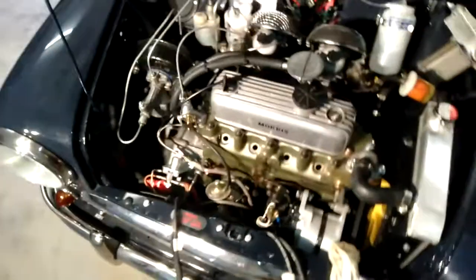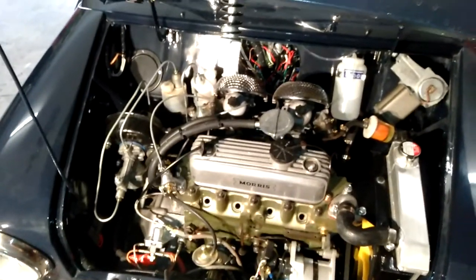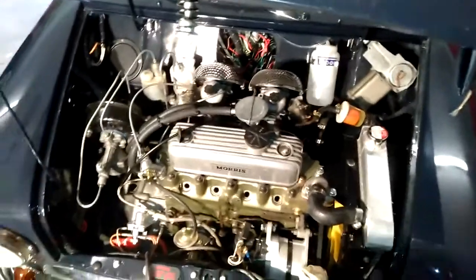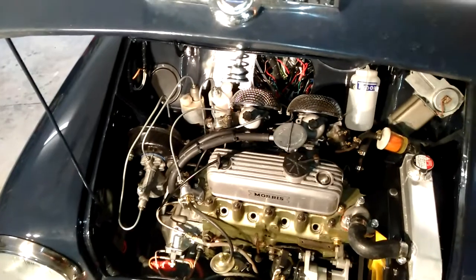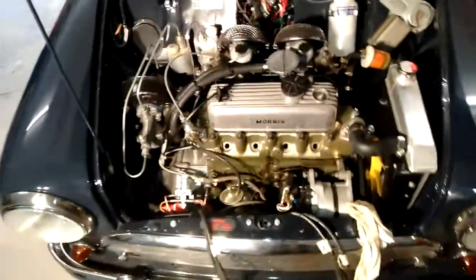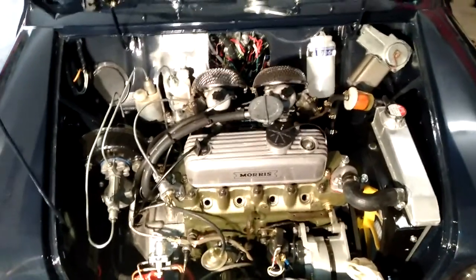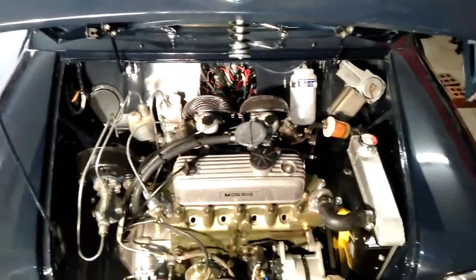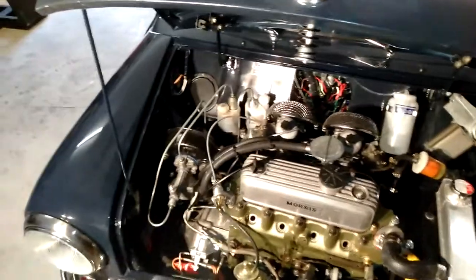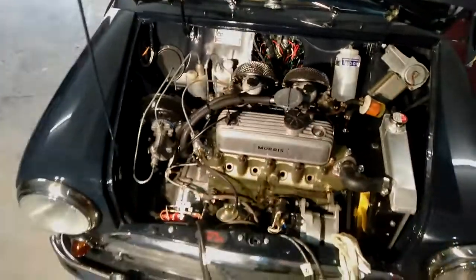The question is whether the compression is correct — some people online get around 180 psi, about 11 bar. If it is losing compression, the fact that all four cylinders read the same amount leads me to think the gauge might be faulty. The car runs fine and climbs hills nicely, so I don't think the pressure is genuinely wrong — but I've never owned one of these before, so I'm not sure. Any comments or suggestions are welcome. Thanks for watching.